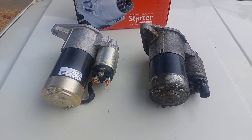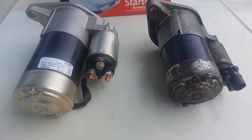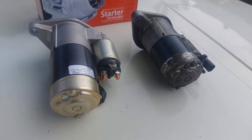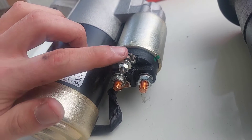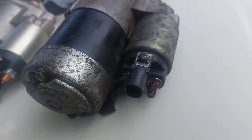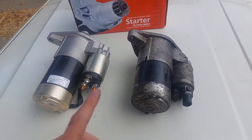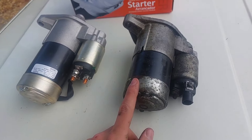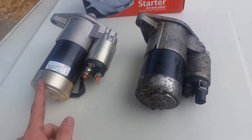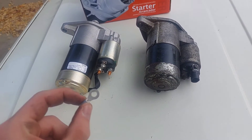Now that we know the starter has failed — kind of disappointing because it's only about four years old — we can get to replacing it. The starter on the 4L has two variations: up to 1998, the connection point for the solenoid ground uses a stud, whereas in 1999 it's a simple plastic connector. This is literally the only thing that makes the starters different, and the only reason the '99-plus starters can be over twice the price. To save nothing short of a hundred dollars, a '98 starter will be going in this '01 Cherokee. The only things you'll need are a ring terminal and some wire crimpers.